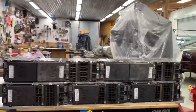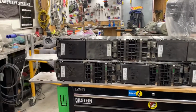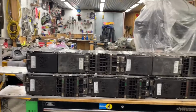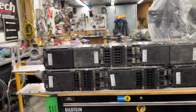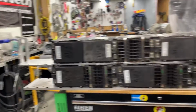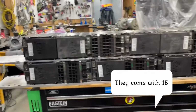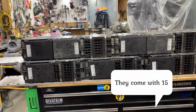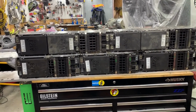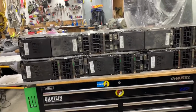This is a pack out of the Fisker Karma. Most of them. This is not all of the batteries. It had like two bad cells in that pack. So this is what will fit in the tunnel of the MR2. There's 14 usually, we'll get 12. This back section needs to get cut off. Because we could have fit it, but we didn't want to cut the structure of the car, A, and B, we want to be able to get this pack in and out from the bottom quickly.